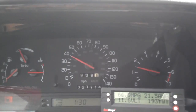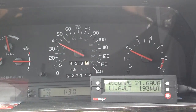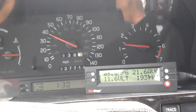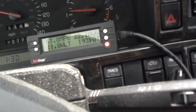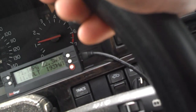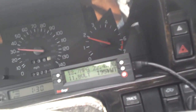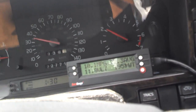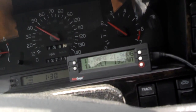If you listen real close, you can hear the bearing on this car whopping. It's normally when you're going real slow, you can hear whoop, whoop, whoop. And then as you speed up, it speeds up with the car. And as you're going highway speeds, it's a real fast, rhythmatic, low pitch sound normally. And when it gets really bad, you can actually feel it grinding through the steering wheel.